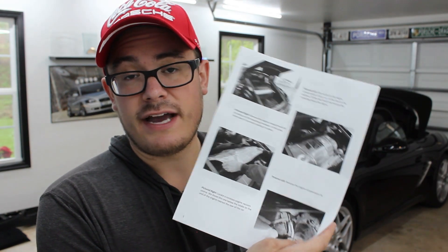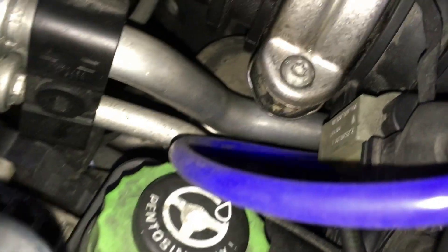I'll include a link to Sol's PDF installation guide in the description below, because it is useful if you're installing this exhaust on a 3.4L S model — but for the base, it's almost completely useless. The pictures are all on an S model, and as you'll notice on page 5, there is no vacuum line directly below the throttle body on a 2.9L base. Instead, we had to cut into a line for one of the plenum actuators.